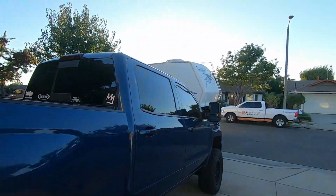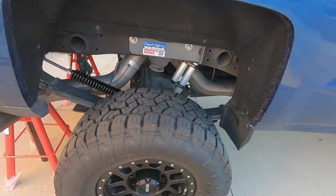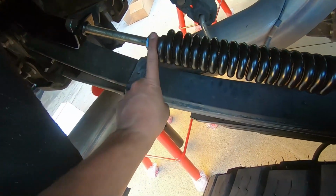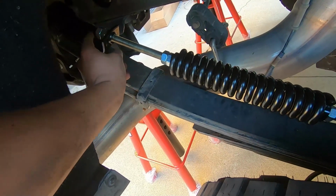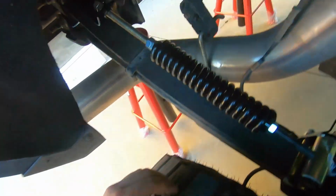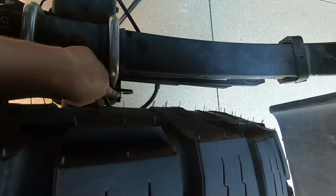Okay guys, we're still doing okay, believe it or not. Look, we got a little bit of daylight. Can you believe it? So anyways, I showed you guys, we got the tension set here, 2 jam nuts locked. Those are locked out of the box. And it's got some little collar right here that over here is squared up with the top of the leaf. This is all assembled in this section here, so don't worry about it. And then that goes all the way down to the 19 millimeter, possibly 3/4 inch on this side. And then we got a 10 millimeter over here that we're gonna do on the shock side. So anyways, we tightened that up. I didn't do that on the video. So it's all done.